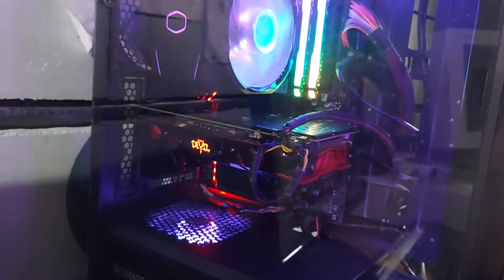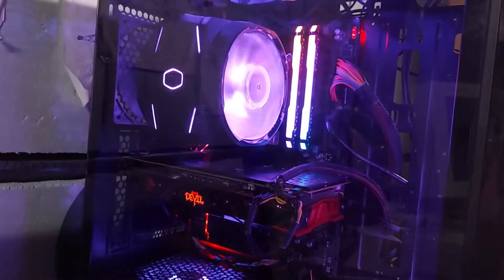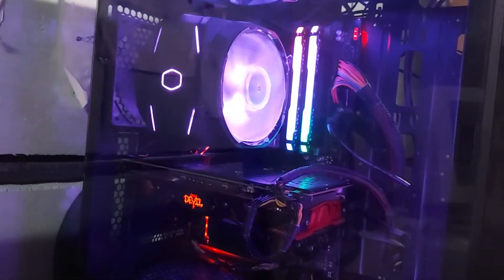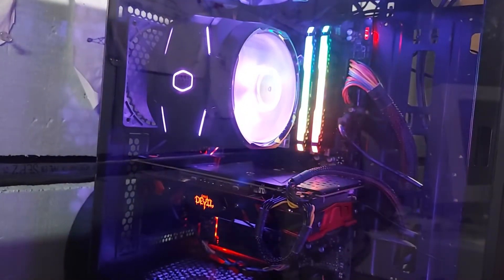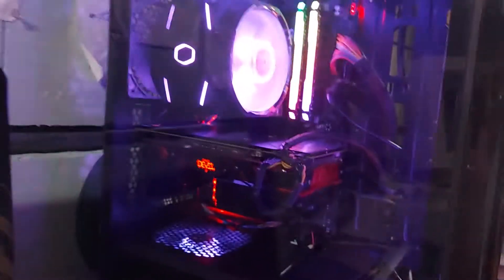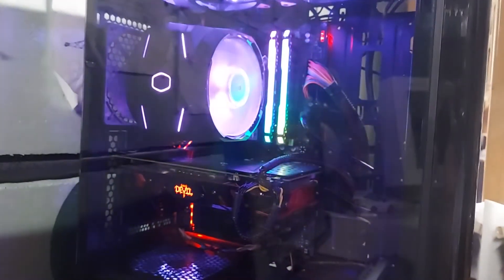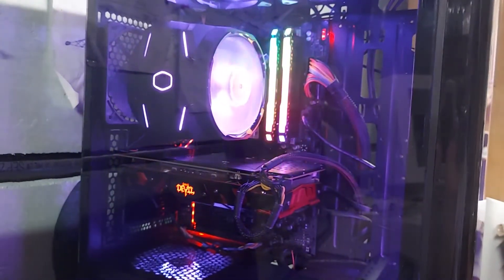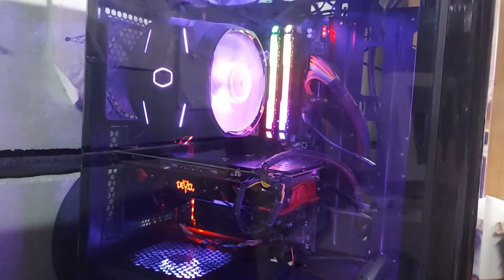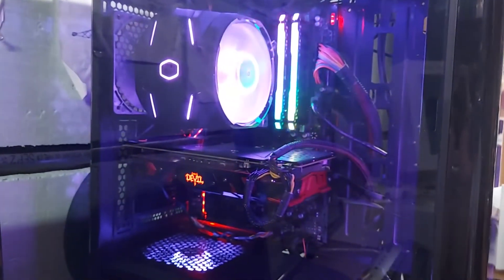It was a little bit of confusion — it won't say exactly what socket type on the instructions, it says it on the side of the box. Since this is an Intel, I just went with the Intel side. By the way, this socket is an LGA 1151 6th and 7th gen processor socket. The processor itself is an i5-7600K. K means you can overclock; nothing means that it can't do that; and T just means it's a really low-grade version of that processor. I did buy this used for $154.